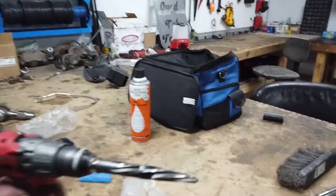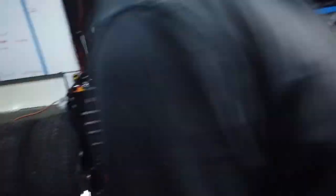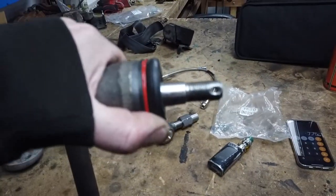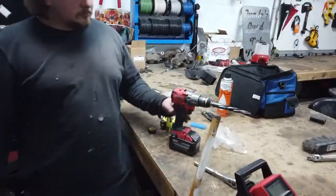Dilly's got this really fancy, really expensive taper bit — as you can see, it's got a nice taper on it. The purpose of that is to give us a nice taper for our tie rod ends to sit into. We're going to taper our steering arm and our pitman arm, and then we can kind of get some length mocked up.